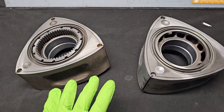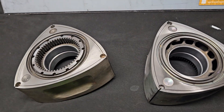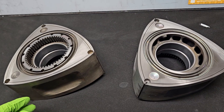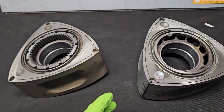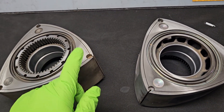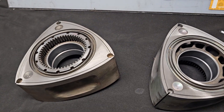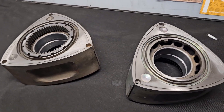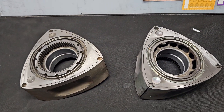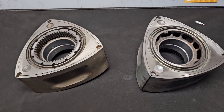This wouldn't be the highest level of protection and performance, but it's a great way to increase the performance of stock rotors and utilize those rotors in a higher performance build. You worry less about shaft deflection, rotor layover, and pinching or breaking your seals. If you do end up getting rotor to side housing or side plate contact, that can cause housing damage, rotor damage, and motor failure — you just don't want that. It's better to have the clearance, be ready to race, ready to rock. That's what we're all about — it's all about the brap. Thanks for watching KMR.